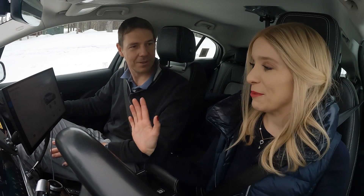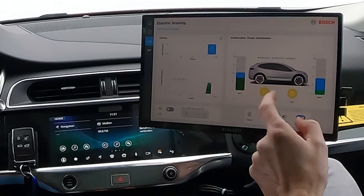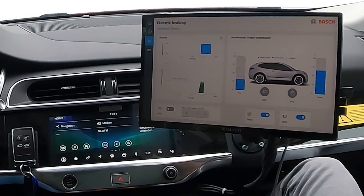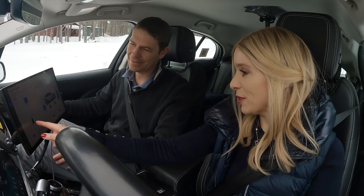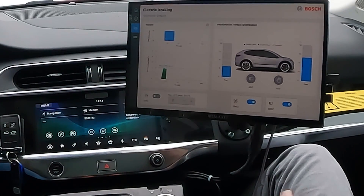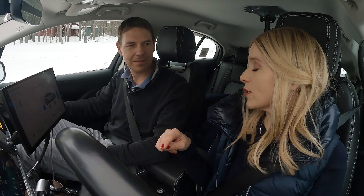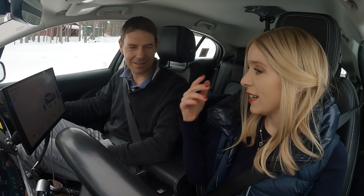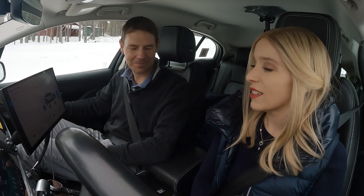Now the feature is turned on — same situation. Wow, that was smooth! You see: braking to zero is activated and now it's held by the brake system. That was smooth, I love that. The green indicator here means we used the electric motors, and no blue because we just came to a standstill purely by electric motors. The noise was also heavily reduced compared to the hydraulic brakes — no brake jerk and less noise overall. More comfort — I love that.